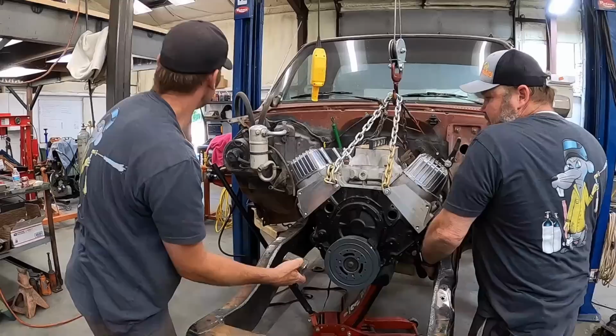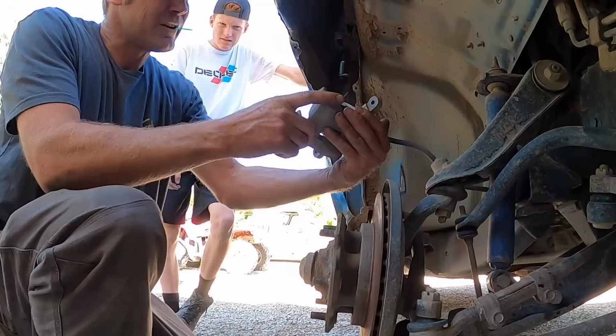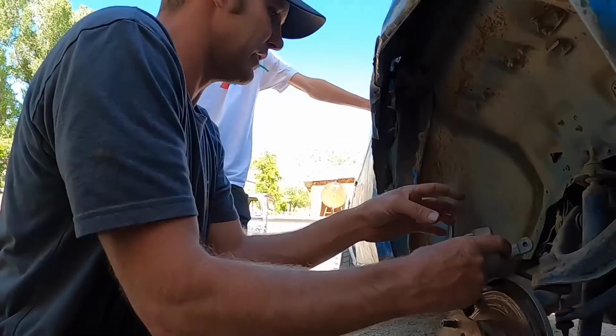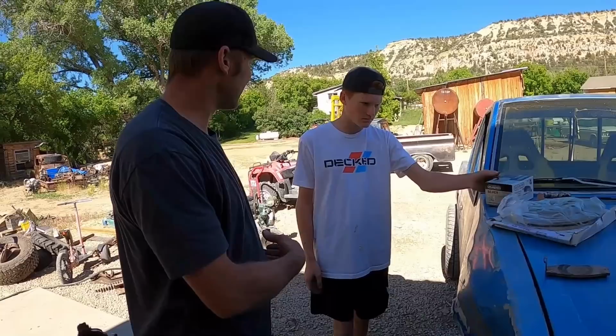The middle one with the cotter pin here, I think the cotter pin will pull that off. Pull these two big bolts out and then that'll come off. And then you put that shoe back in there, the brake pad. Get the C-clamp and clamp it in and it'll push this all back in. Then you fit your new brakes in it. And then you take this off and pull the whole wheel bearing off at that point, and then we gotta pound the rivets.